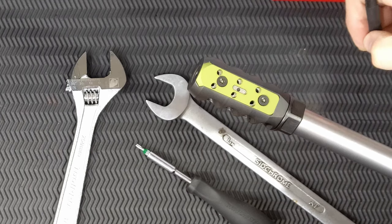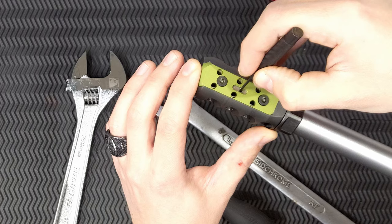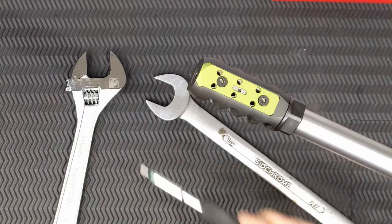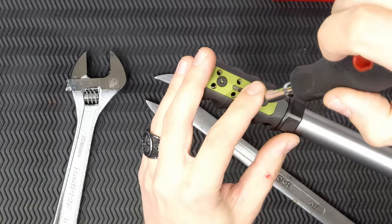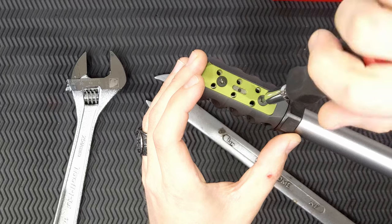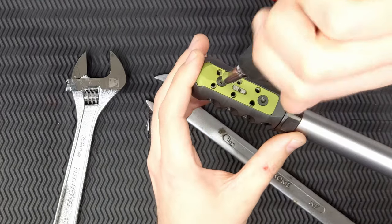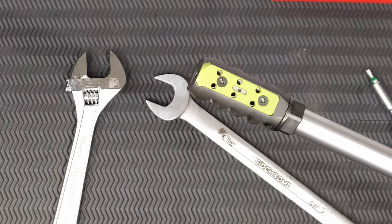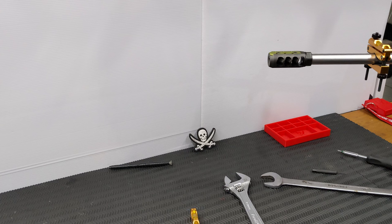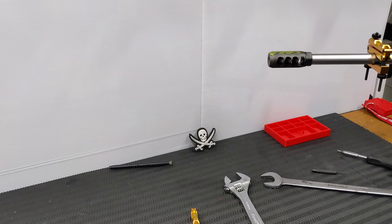Then you can go back to halfway, or all the way on. I'm going to start about halfway — that's probably a good place. They don't actually specify any torque setting for screwing these back down, but obviously firm as required, and they want you to go back and forward between the two screws, which makes sense. If this comes out of adjustment slightly it's not really going to ruin your day quite like if your brake came loose. But it's always good to have them torqued down correctly. Once I find a position I'll take it all out, apply Loctite to those threads, and clamp it down in the desired position. But for now that's where I'm going to start.